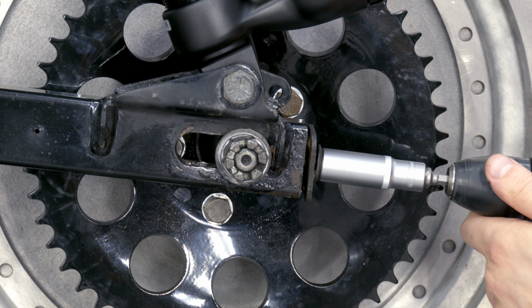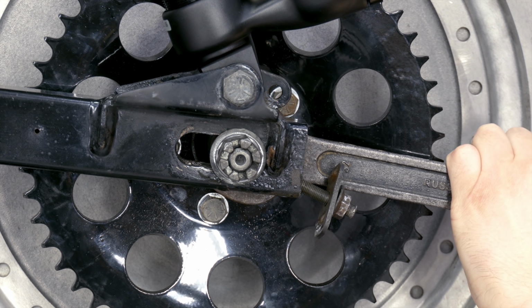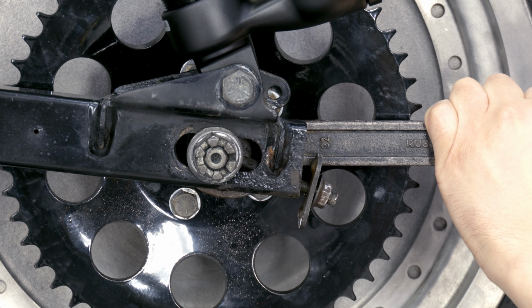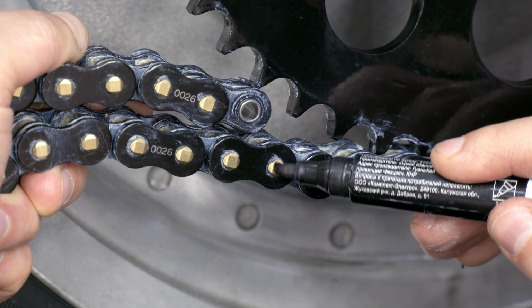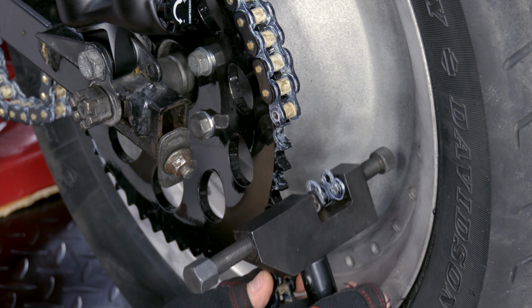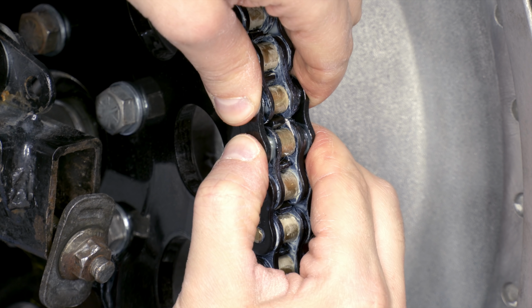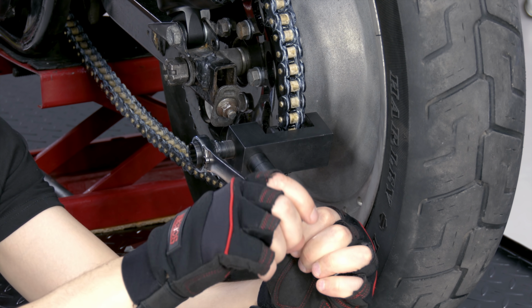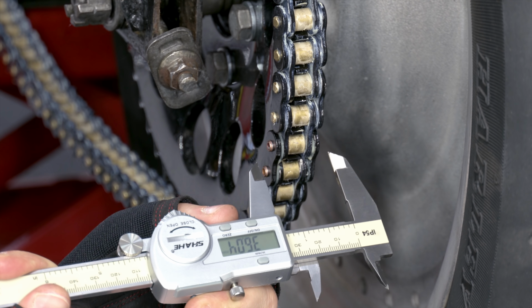To install the chain, it's necessary to set the minimal tension to define its length. Also, the shorter the wheelbase, the easier to make wheelies. The video on how to install the chain you can find on our channel. When assembling, it's important to control the width of the master link, not to overpress it.